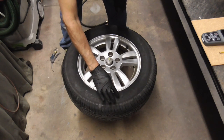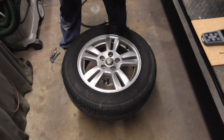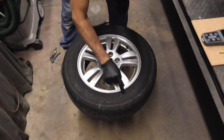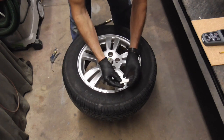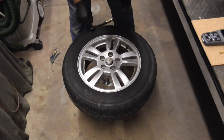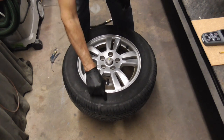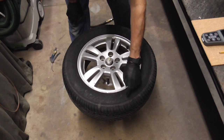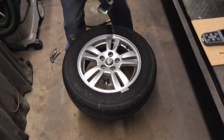It looks like we're going to need a little bit right there, right about there on the F. They have these little stick-on weights and we'll just tap one in at a certain spot — it should look the same each time. I'm just getting it to where that bubble is right in the middle. Put three of them there, tap it, and I need a magnifying glass to see perfectly.